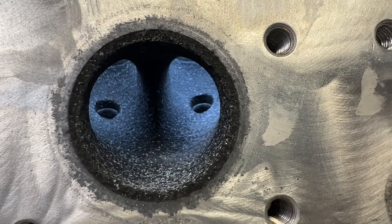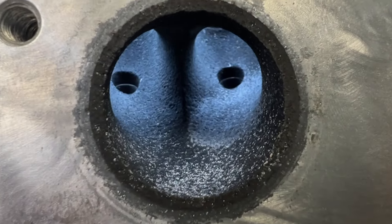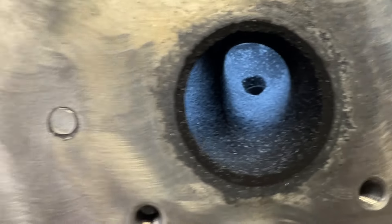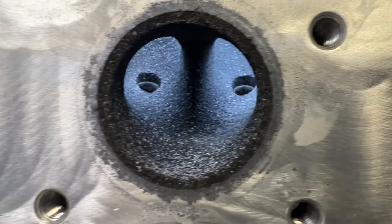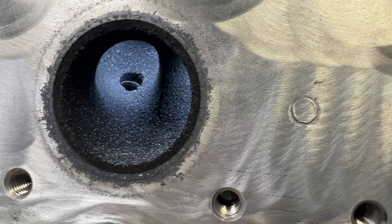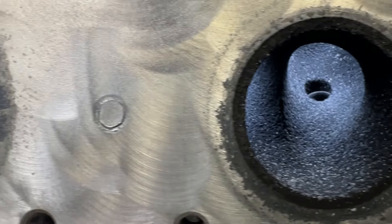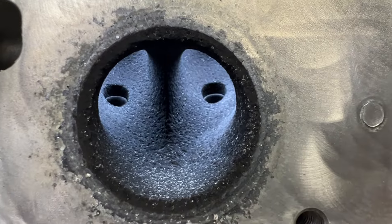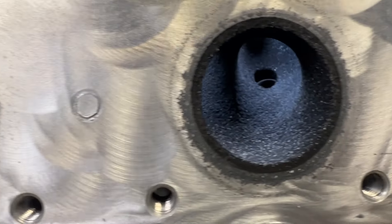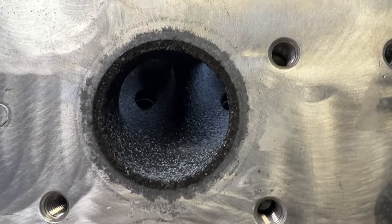The exhaust port — I really didn't see anything to yell about. This thing looks pretty good; I cannot complain. It looks like it's running very well. There is some carbon to be expected. I think maybe my man Dan should be racing a little harder. This thing sees hours of in and out of full throttle, many many seconds of full throttle, and it has 3,000 miles of hard, hard driving on the road race. This is not a street car at all.